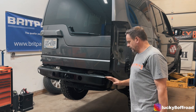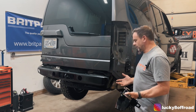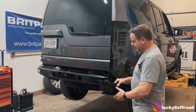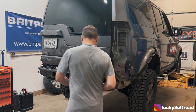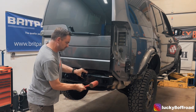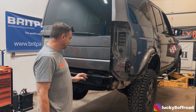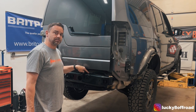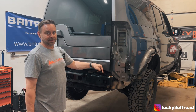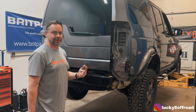With the little piece at the end cut off and out of the way, it's time to install the swing away bracket. I recommend just hitting everything with a little bit of spray paint. Cleaned up the whole bumper here, as you can see. I'm going to put this on — I already brought my friend, Mr. Mallet. It does not want to go on real lovingly. So what I'm going to do is install this bolt back here so I can cantilever it and then tap it in place with the mallet. Once it's in place, I can mark and drill that first hole — that'll hold everything in. Then you can drill the rest of these bolt holes out and get them installed.